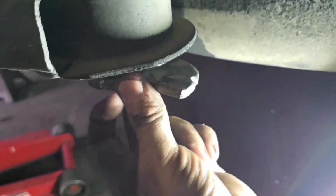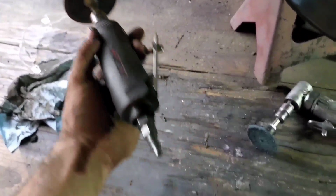Okay, final bolt on the lower control arm. Take your impact, your swivel. See where it's at. Your wrench. Put it on there. Alright, on a Cradle Lockout Kit, this piece is on here. They want you to drill through this, but I just took a cut-off wheel, cut the side and pried it off. Then this little rubber piece that's on here, you take a razor blade or a good knife and cut it off flush.